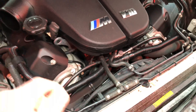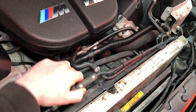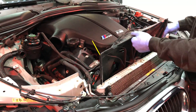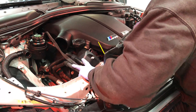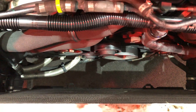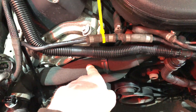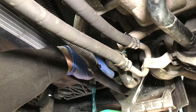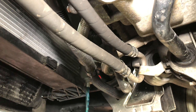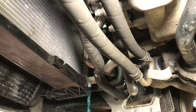Next up it's moving off the hoses and moving the wiring and getting all that out of the way so that we can get the electric fan lifted up. The electric fan needs to come out, which is always quite a tight squeeze. With that out of the way we get much more room towards the belt drive system, though we still can't see the Vanos pipe — it's quite hidden. Next we need to take the upper radiator return hose off, draining the antifreeze out of the radiator so we can take off the radiator hose to get access to the top of the engine block where the Vanos pipe is held.